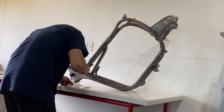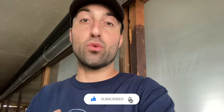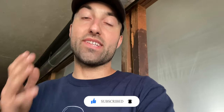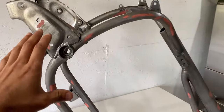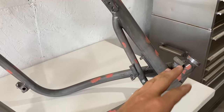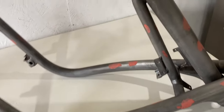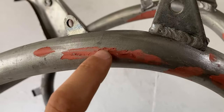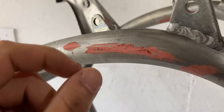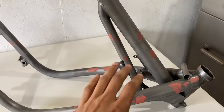I successfully filled in most of the pinholes on this motorcycle frame. Before I go ahead and sand it down I have to wait 25 minutes — if I don't wait long enough it will clog up my sandpaper. Here's a close-up view on the frame; you'll notice all the pink areas have been filled in. There are quite a few pinholes around the frame everywhere, so everything has been filled in. Make sure everything is dry — if it still feels a little soft, wait another 10 minutes.